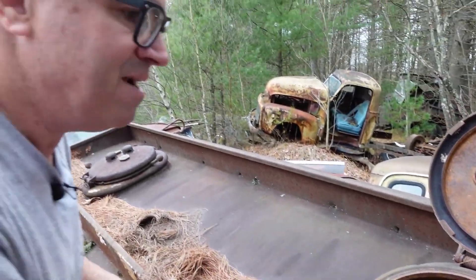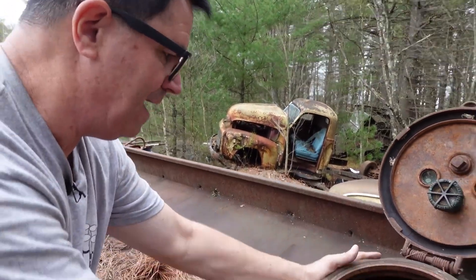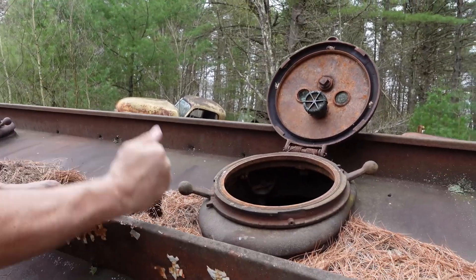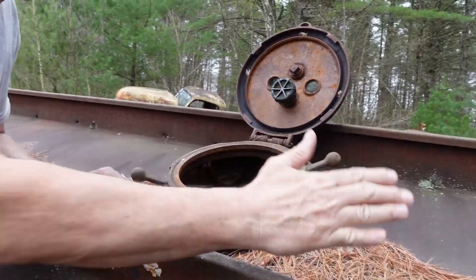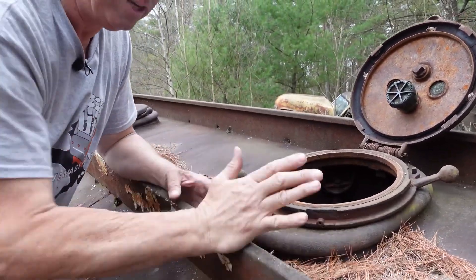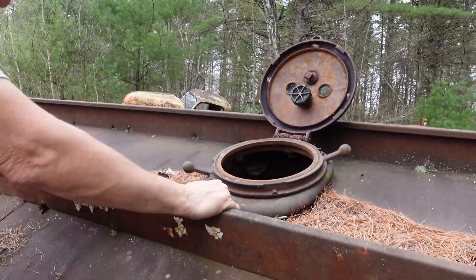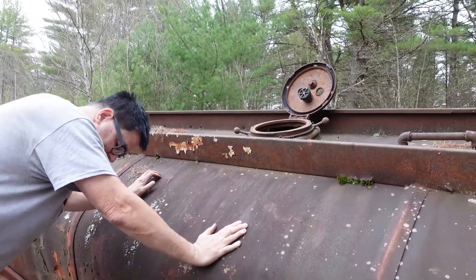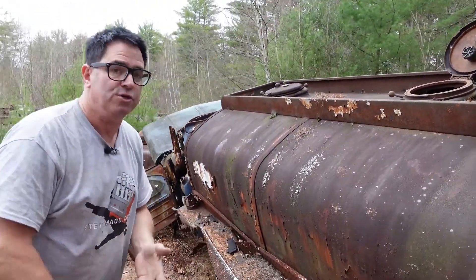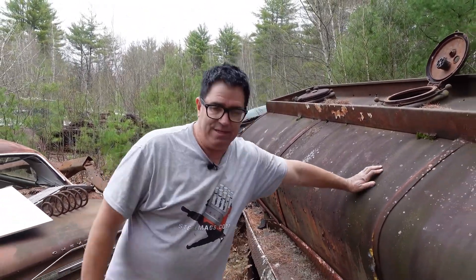The science of these things is more than meets the eye. And speaking of that, this raised area here around the filler openings is here so that in the event this thing goes upside down, the tops of these things don't get scrubbed off as this thing goes down the road. So these are a safety feature that was mandated. These walls are pretty rugged stuff. But again, this is a steel tanker, and these were the rule starting around 1910. Before that, wood was used with horse-drawn trailers. The steel was phased out in the mid-'70s in favor of aluminum, which is more expensive and lighter, but doesn't spark and cause fires — especially with gasoline delivery, aluminum is mandatory.